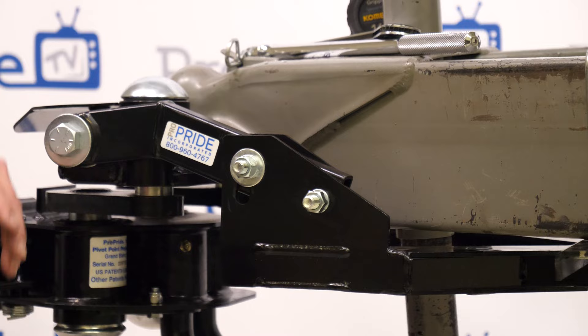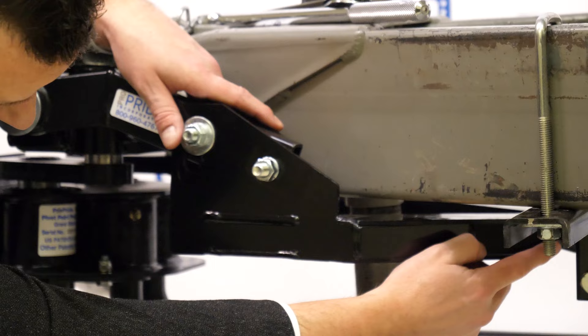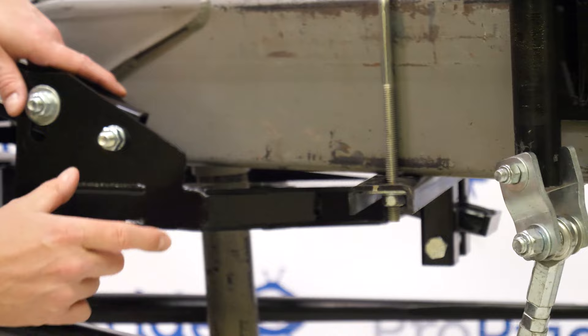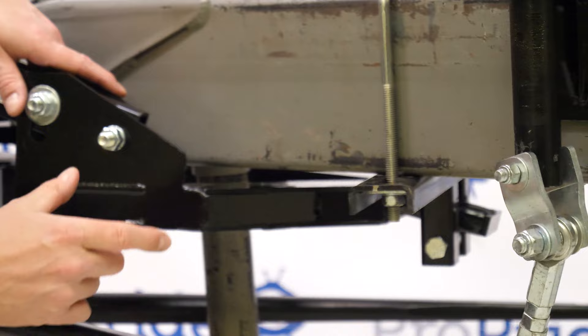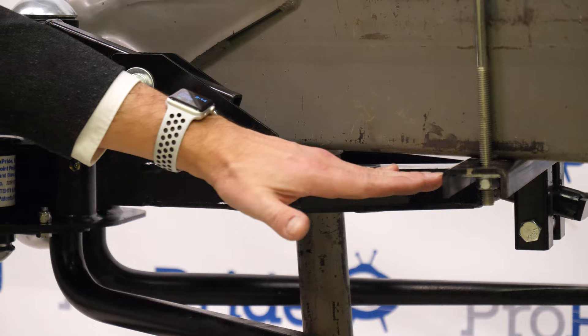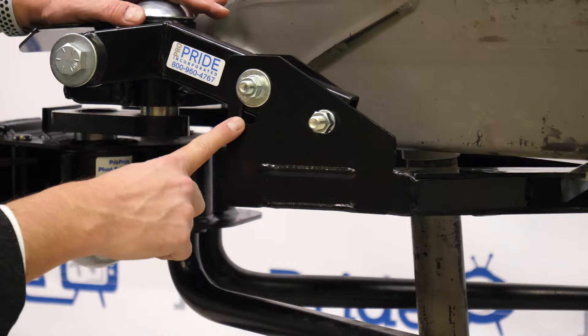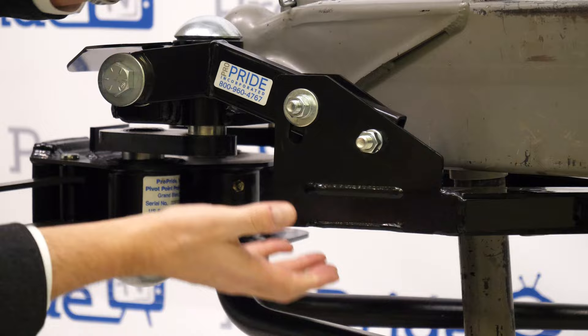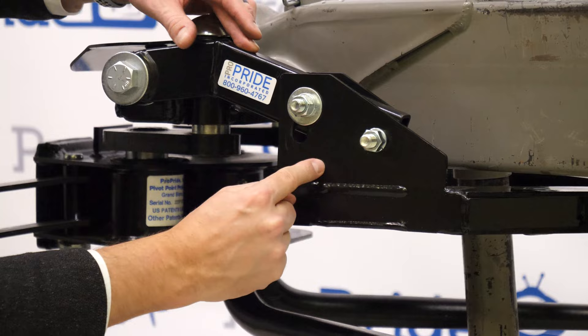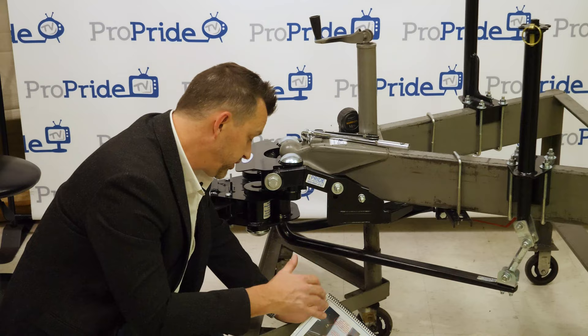For the yoke installation, center the yoke tail and cross beam on the downward forks as much as possible. Keep the yoke parallel to the trailer frame — as long as you have about a half inch of clearance, you're good. You can adjust parallelism by loosening and moving the bracket up; the unit flexes specifically for this purpose.